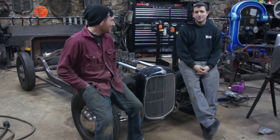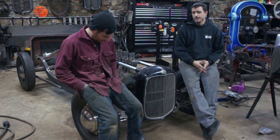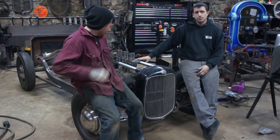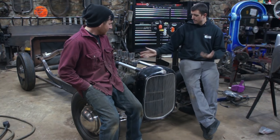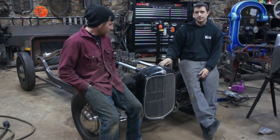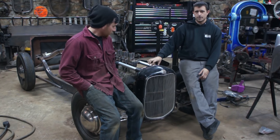After we started looking at things, we realized we actually needed four hoses, not two. The 90s worked perfectly for up top on the Pagoda City Coupe. The metal pipes actually have the bend in them, but the way everything worked out it's easier just to use the silicone hose. We got straight pieces of pipe and it's basically done. We do need to figure out a reducer setup for the radiator though — the top of the necks are actually smaller, so we need either a reducer hose or to weld on a reducer to the pipe. We haven't figured that out yet, but it's basically done — all mounted and it looks awesome.